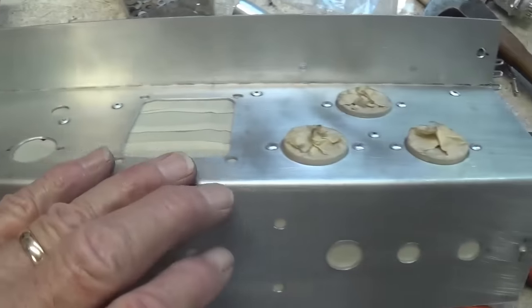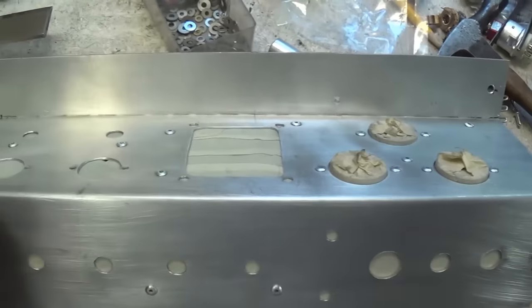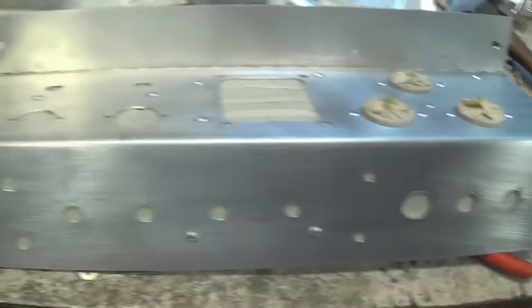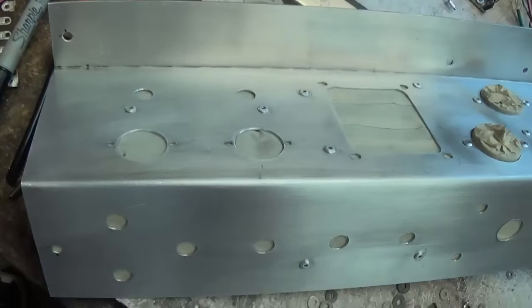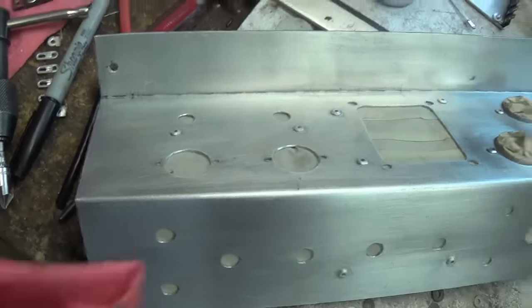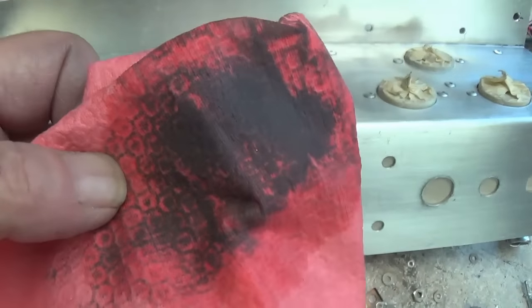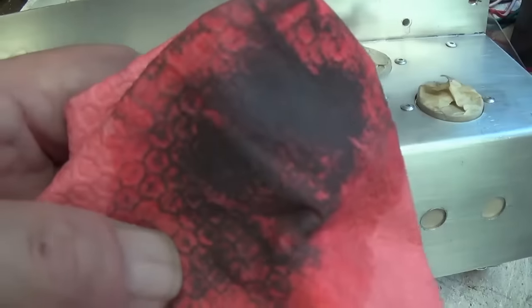The one final step before the spraying begins is to cleanse the surface with some really stout degreaser, like lacquer thinner or 409 Windex, to be sure there are no big fingerprints to ruin the paint job. I personally think this final cleanup prep may be the most important step in the paint job. If you thought this looked really clean and shiny, look at what came off it - that was just the first cleanup attempt. I'm going to go with a clean portion of my towel and go over it a couple more times until I don't see this type of mess.